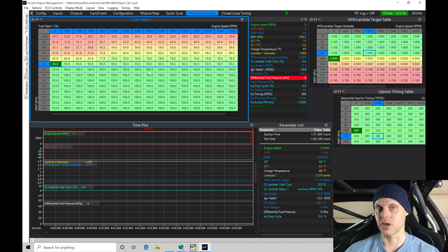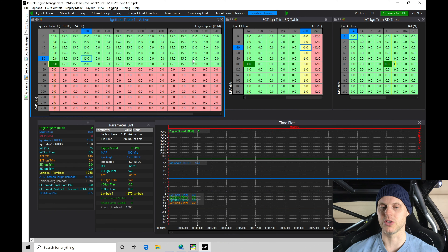We're going to get started with the calibration process for fuel first, then move into spark timing. Looking at our spark timing table and ignition tuning, we've set this table to 15 degrees — which is really low right now. I'll go through the process of showing you what to look for and how to calibrate this table. Most engines will run anywhere between 30 to 35 degrees at lighter throttle in the part throttle region, and then the timing tapers and retards as we get up in engine load. I'll show you how I shape my tables so you can follow that same process on your vehicle.